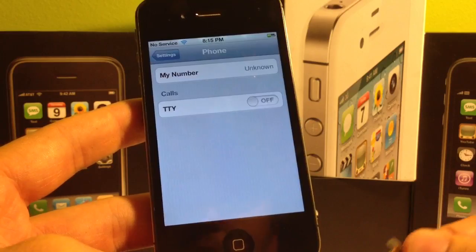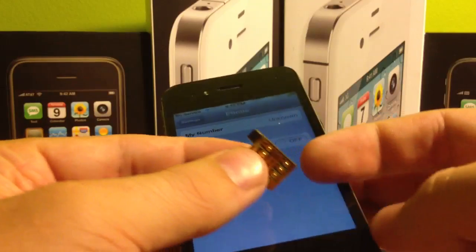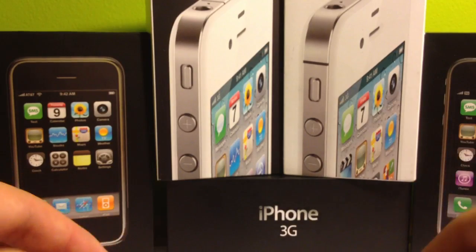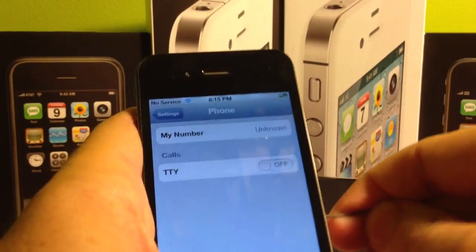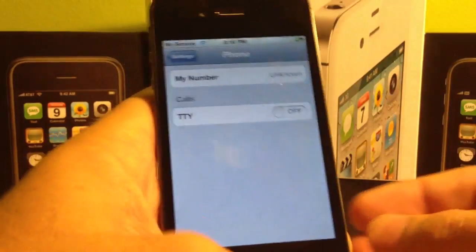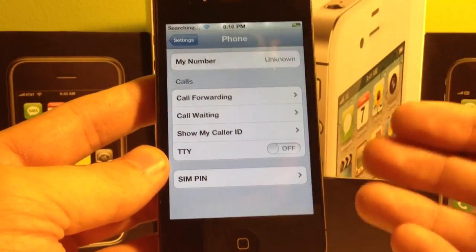The phone doesn't even recognize that anything's in it. The reason being is because when an RSIM fails, it actually fails - it's not like it'll kind of work or only works every so often. If any connections are broken within the microchip for whatever reason, it just won't even register that there's anything in the phone at all. So if you're popping your SIM card in and out and no matter what you do it doesn't register, one thing you might try is taking out your SIM card, popping out the RSIM, putting your SIM card in alone, and then seeing if your SIM card registers in the phone. See, it pops up and says there's a new voicemail - obviously there's not - but it just went through all these changes, so we know it's making a connection.